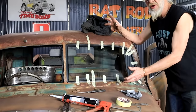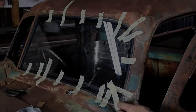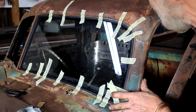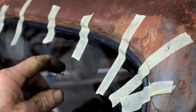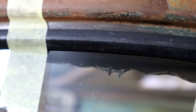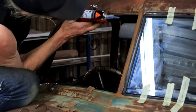So far so good. That certainly got me heated up, but it's in and I can relax a little bit now. I've still got this black stuff all over my hands — it just jumps on you. I'm using pieces of masking tape to hold the T-section rubber in place while the polyurethane cures. It's invention on the go. It's certainly a lot quicker and easier than my previous method of tooling the squeeze-out. The squeeze-out you can see is on the inside — I'm going to clean that up mechanically once the stuff is cured. I've had some practice with the first one, so let's see how this second one goes.